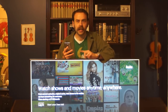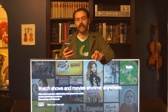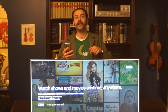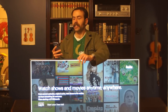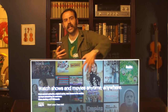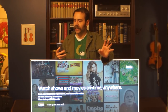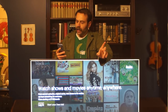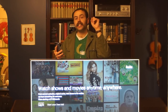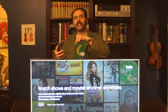On the negatives side, people are talking about dirty screen effect — I'll try to show if that is an issue with the set I received. Some people's sets have had banding going across or whiter areas in the corners, and backlight bleeding. Also importantly, this is not a native 120Hz refresh rate — this is still a 60Hz panel.